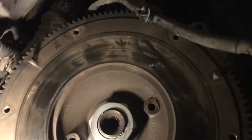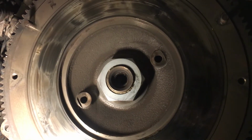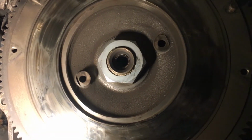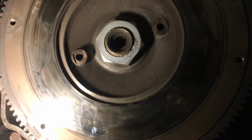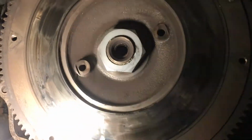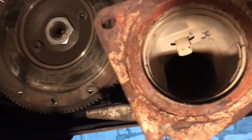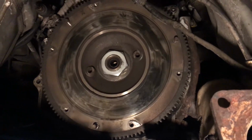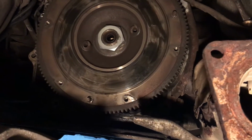We have a lot of residue. I think the clutch was just worn out. I will try to clean it off somewhat. We can see discoloring over our flywheel. We have grooves in it. It is not flat. I see that it could be ground a little, just give it to someone who will take out the pins and grind it down.